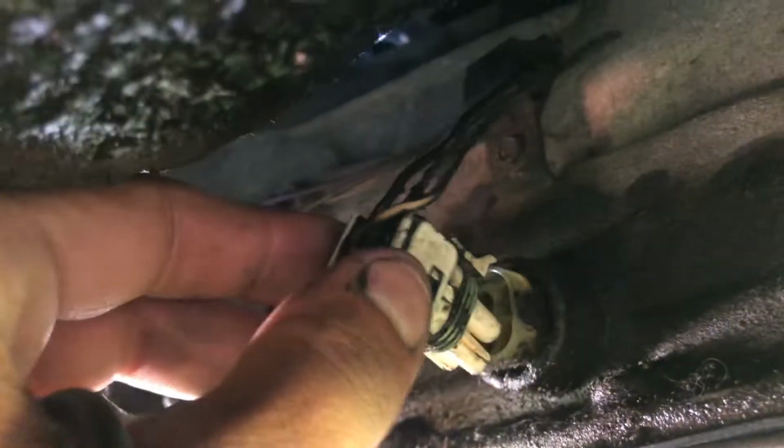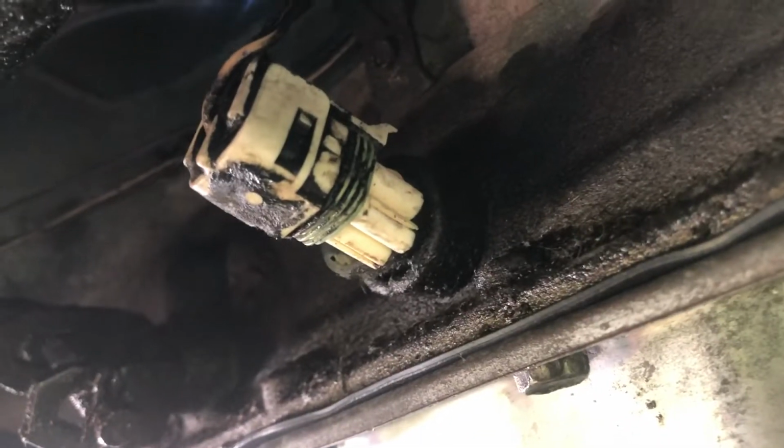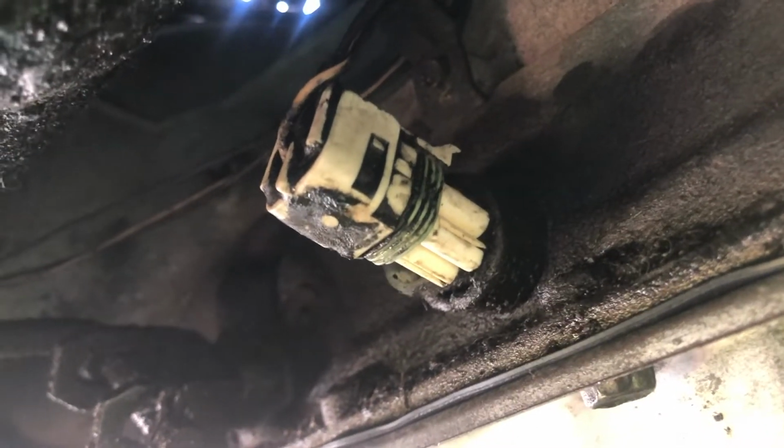But anyway, for testing purposes, to make sure that the solenoid works, I do have hot power to it right now. It is grounded, so here's your test light, for example. Pin A is the one up top on the left hand side. It will be hot. The one directly across from it is your ground. There is a wire inside the transmission that goes to the fourth gear pressure switch. A lot of people say you can hook them together, and then once it hits fourth gear, that's when your lockup will work. That would work out great with the 200. Certain ones don't have it, so that's where you gotta use your thinking cap and make it work another way.